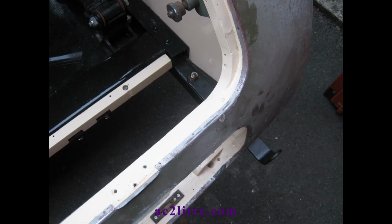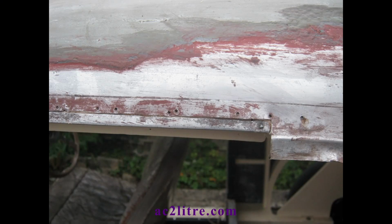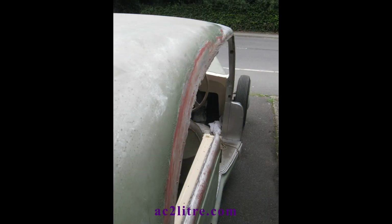Firstly, the sheets of heavy-duty polythene wrapped around parts of the wood frame came out nice and easily. The front end of the shell was not going fully down because the roof needed to move a millimetre or two forwards. A useful reference was the row of nail holes for the guttering. I did some panel beating along the right-hand side of the shell using the wood frame to get everything straight, and this eventually allowed the shell to move 0.5 of a millimetre forwards. That was nearly 5 hours' work.